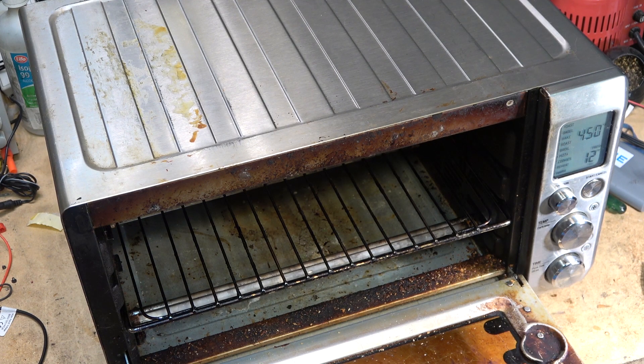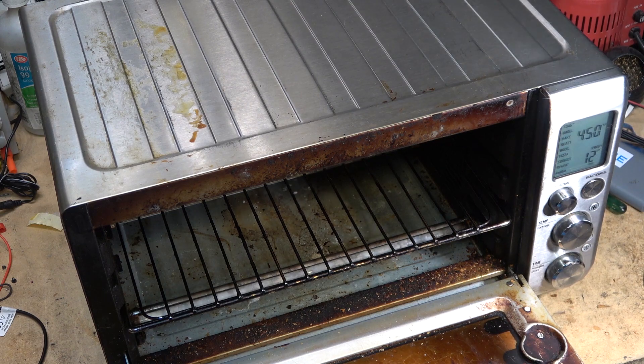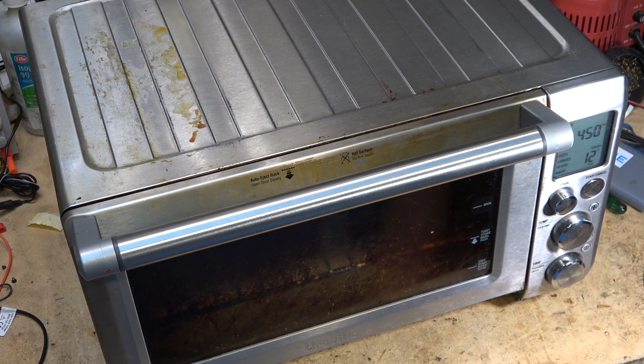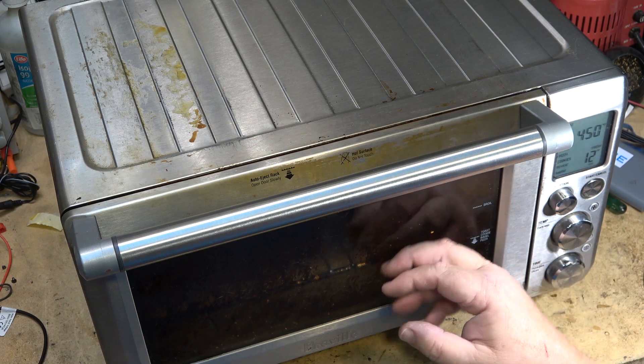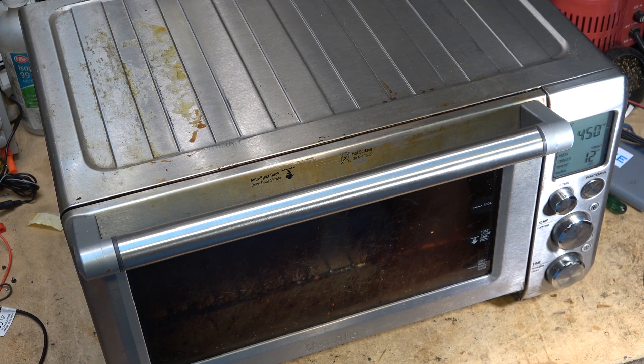When it was turned on its side the bearing was free, but now the weight is sitting on the bearing from the weight of the fan and it's not spinning — so the bearing itself is shot. Unfortunately I'm going to have to let the owner know they're just going to have to turn off the convection and use it as a conventional oven. The amount of work required to take that thing apart — just to get into the side cover was a lot of work, and to actually get into here to take this motor out the whole side would have to be taken apart. The heating elements are quartz — three on the top and two on the bottom — and they would all have to be removed to get in there to change it. And it's gross. When they get old like this, maybe it's better just to buy a new one when the convection motor is shot. This thing has had thousands upon thousands of hours — used pretty much every day, seven days a week. So I'm not surprised it's burned out. Anyway, thanks for watching.